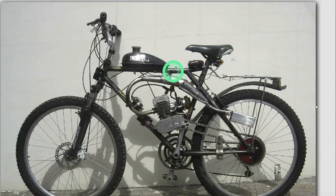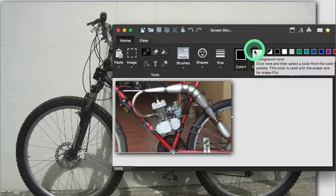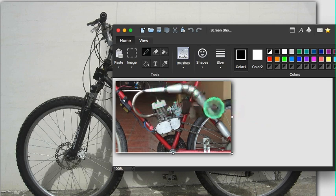This is not the pipe that's on it right now, but I wanted to show you this. What you're looking at is a belly stinger — it's not going up in the center of the belly cone. There's a hole in the side of the belly, and a channel is welded to the outside of the pipe and then goes to the stinger pipe, which goes to the silencer — a special design I got from a friend in Russia. It's complex to build but it works really good. The pipe I have on it now does have a center belly stinger.